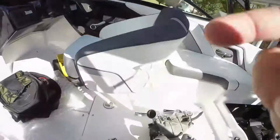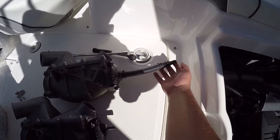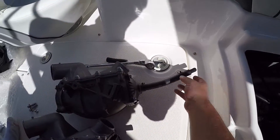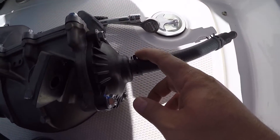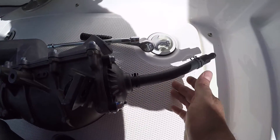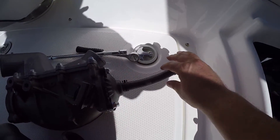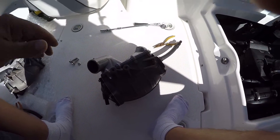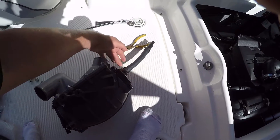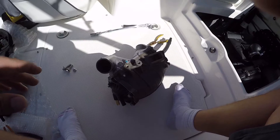Just to show how much larger the SVHO intercooler is — it's quite a bit bigger. This is the water inlet line I was talking about with the coupler. It's easier to undo it there because this clip is hard to reach while it's bolted into the boat. So you undo it there, pull the whole thing out, take it off, and attach it to the new SVHO intercooler. I've got that line connected to the inlet on the bottom of my new intercooler and we can now begin installation.